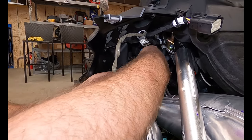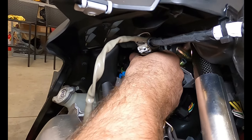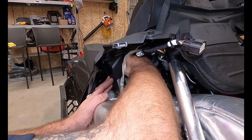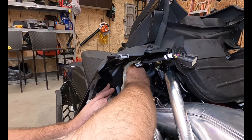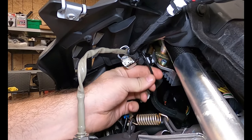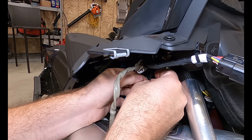So that's where we've fed our RCA plug in — grab that from there and plug it in. Make sure that you have it so that the clip catches it. You can see the female end right here; set that into there. It's hard to see on video, but when you're doing it in person you can feel it clip in — you basically have to do it one-handed as well; it's pretty tight in there. Once you clip it in, grab your zip tie from the kit and zip tie the wire right to your main harness that clamps to your hood, so it doesn't hang down and hit the exhaust.